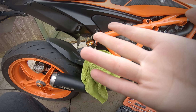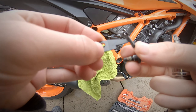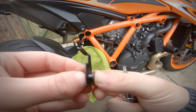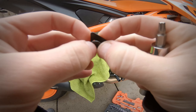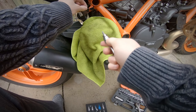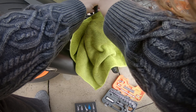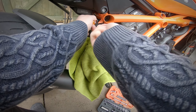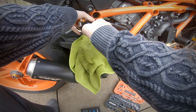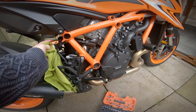Just above hand tight. I've got some fluid on my hands so I'm glad I put that rag there. Looking at the metal on the guard — that's been bent in, you can see that. It can't go back in properly so it needs to be straightened. Come on KTM, that's a bit stupid. Clean out some metal debris from in there. Be careful when putting this back — you don't want to scratch the top. Just hand tighten this back up. You can change the angle of the master cylinder reservoir if you want to keep it upright.